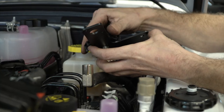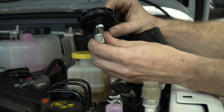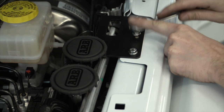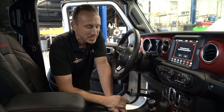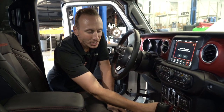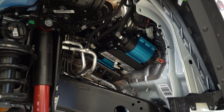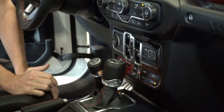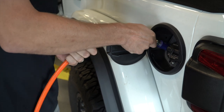To turn the compressor on, we've got to go inside and push the auxiliary four button. Once you're inside the Jeep, turn the ignition on to the run position and then hit auxiliary switch number four — that will turn the air compressor on. When the air compressor is on you will hear it run a little bit to build up some pressure. The compressor has a built-in high pressure switch to turn it off or on when the pressure is high enough or low enough. When you're ready to use the air system, all you do is open the fuel door and plug in the airline.